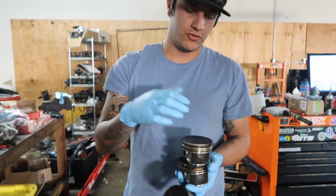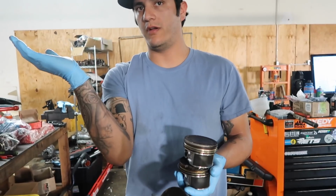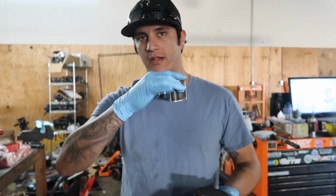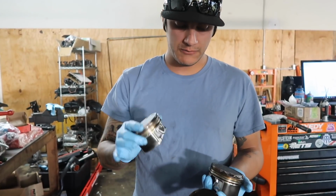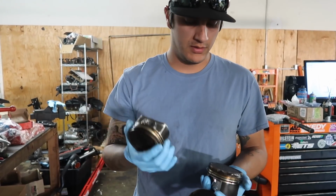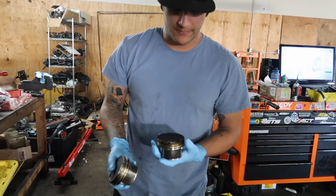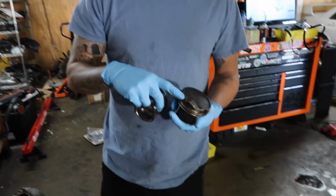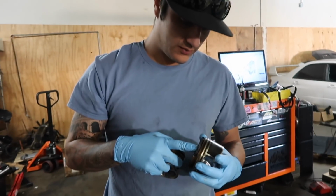What a lot of people do is they go straight into neutral, and what happens is you go lean, you'll see your AFR gauge just sit at the lean. Yeah. What you're doing is taking all the unwanted air in and not enough gas. What you should do is just let off the gas, but cruise it. Keep it in gear and just keep coasting. The engine, at least your tuner, should tune for that. We do it here at 5150. But that's contributed to just bad gas. It's really bad, man. That's horrible. That's really bad. So we're building his motor.